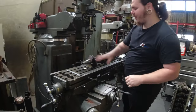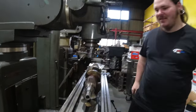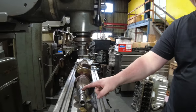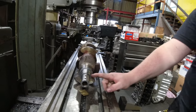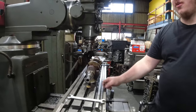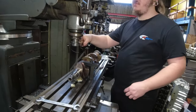This is why I fit it that way, because this is the way the crank likes to sit. Right, so then you drill the hole at 90 degrees to the flats. Straight in here where nothing needs to go. Obviously you can't put it in here because that's your seal area. You don't want to put it in there because it's thinner, so you end up drilling further through. When you think about it, any hole you put in here makes this snout assembly on your crank weaker.